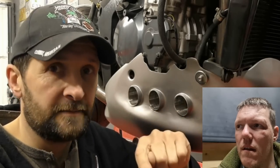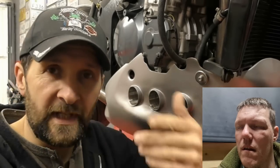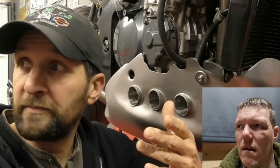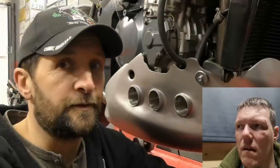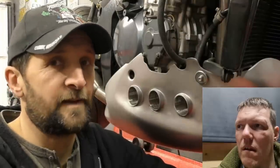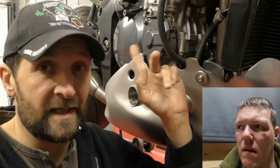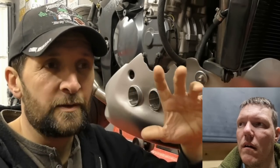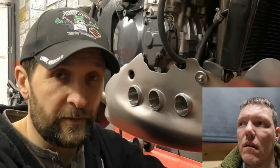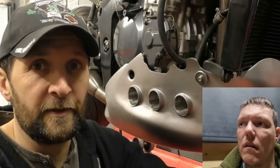Now, it's come winter time, so at night it gets to about 2 degrees in here and it's all metal and stone. Then I come in during the day to work and put the heater on and the air temperature gets up to perhaps 20 degrees and the metal temperatures get up to about 10 or 15. That obviously has the effect of possible condensation, and the condensation I'm talking about is the damaging stuff inside the engine. When the engine's got air inside it, if that air is in any way moist, as soon as you get a hot-cold transition, you get water droplets forming. If that forms on stuff like the camshafts, it's very important. It will still happen, no matter what you do.